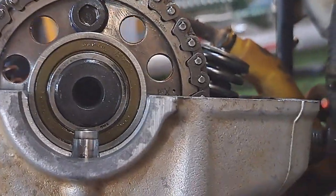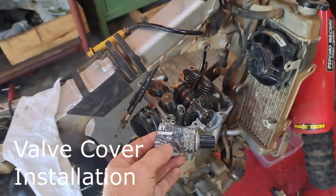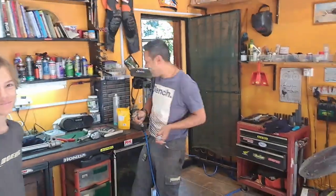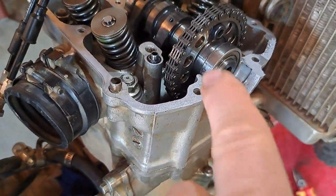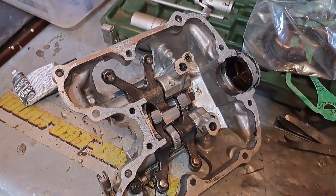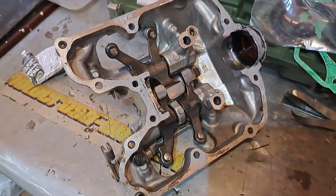New day - time to reassemble. You need to put gasket maker over the outside surface. You don't need to put a heap of it on there, just enough - tap it on with your finger and that's plenty. Cover it but don't blob it on. I cleaned the surfaces with acetone on both the lid and the head, then dabbed on the gasket maker - mostly on the head and a little tiny bit on some of the hard to reach areas inside.